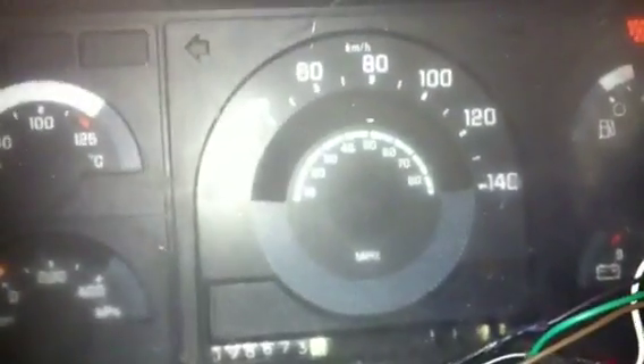I'm going to show you the dash. Here's our plow truck dash. I turn the key and you can see the engine light comes on — the engine light would not come on before. That tells me I have connection to the computer and that the computer is on. Everything's lit up and everything looks well. Turn the key and she starts. The IAC motor, the idle air control, is doing its job. Our computer has full-time power.